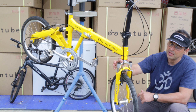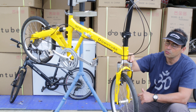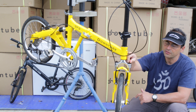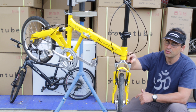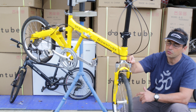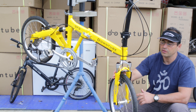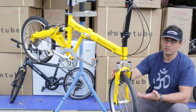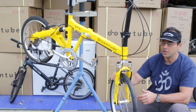This is called the crown and it's all aluminum — beautiful and lightweight. We have a preload adjustment here on the left arm. You turn it clockwise, you're going to increase the preload; counterclockwise, you decrease the preload. The preload is where the fork begins its engagement. So if you don't want it to engage as fast, you can adjust that, or if you want it to engage instantly, you can adjust for that as well.